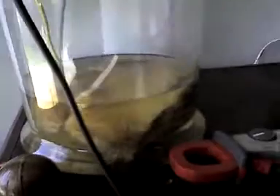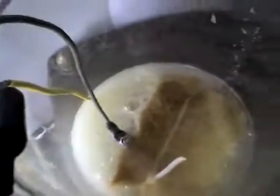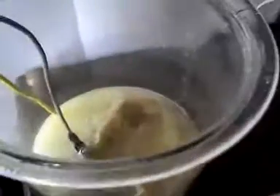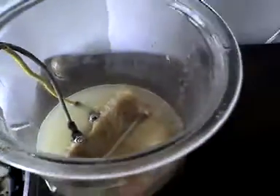We're going to be able to see perfectly the amount of hydrogen that will be produced. As you can see clearly, this is a very large amount of hydrogen in a very small space. The consumption is equal to 68 amps, which is why I recommend that whoever is using this kind of system have a separate electric system on a separate alternator.